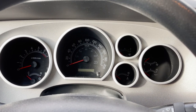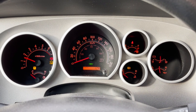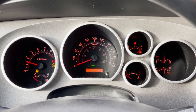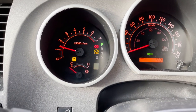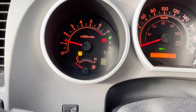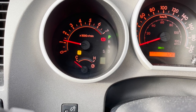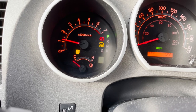With the pins shorted on the connector, start the truck. Once started, you'll notice that the cruise, ABS light, check engine, and traction control indicators are blinking in an alternating manner. The next step is to put the transmission into temperature monitoring mode by toggling the transmission between neutral and drive several times in succession within a six-second window until the D indicator illuminates, confirming you've successfully entered temperature monitoring mode.